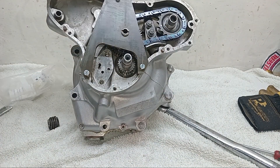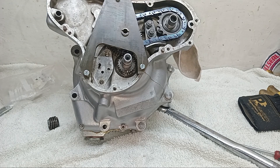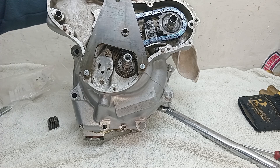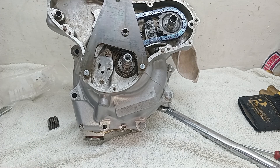That's going to stop the crankshaft from turning around. I'm locking the crankshaft and I'll just get a small bit of rag to protect the mouth of the crankcase. The other way of doing it is to put a bar through the conrods through the small end, but this way is easier if you've got the tool.